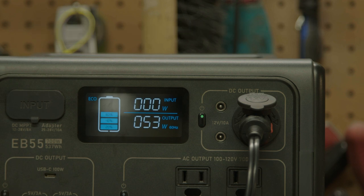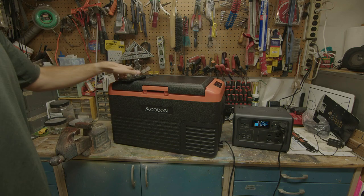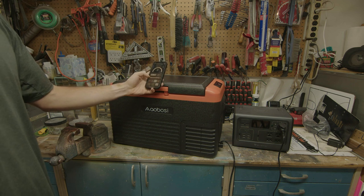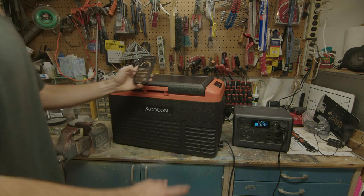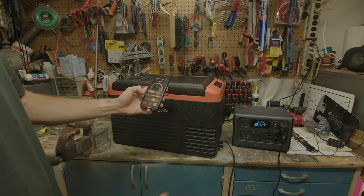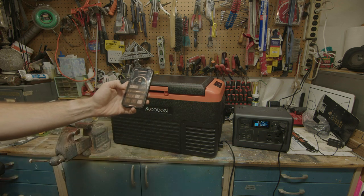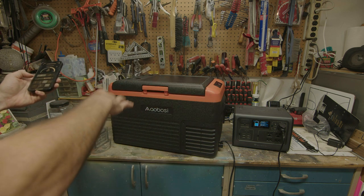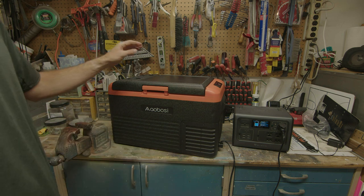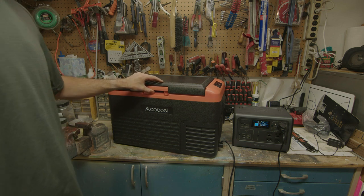It got to about 50 watts — the max was 53. I kind of like being able to control it through the app. We're still in the 50-watt range. Let's put the temperature to something more reasonable, like 33 — and instantly the compressor turns off. These compressors cycle on and off until they reach the proper temperature. If you're dropping it way down low, expect to see it hit 53 watts, but it's not going to continuously pull that. Once it gets cold, it's done.